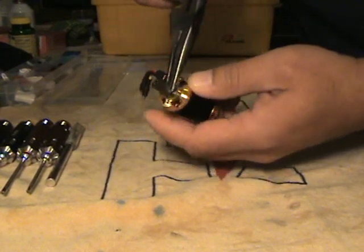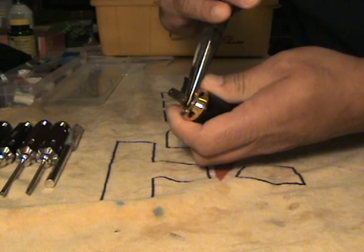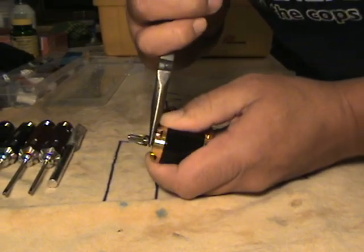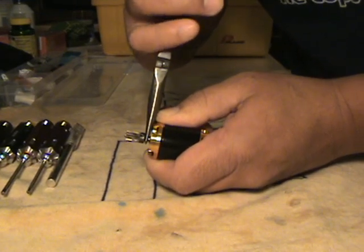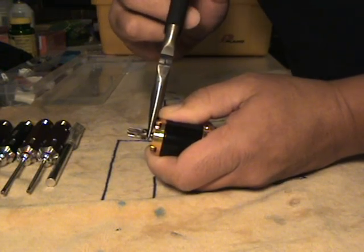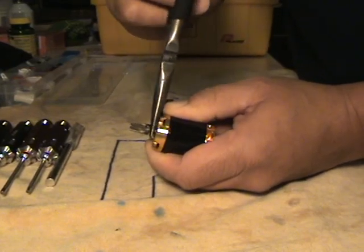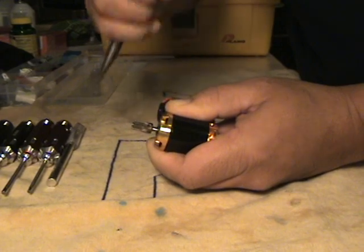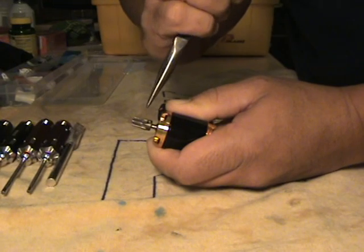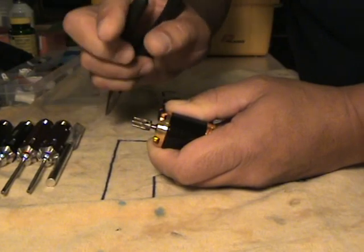Be careful not to pinch these wires here, and just give it a very slight prying action until the pinion moves a little bit like that. You don't want to pry any more other than just to get it moving, because what you'll end up with is this huge angle. If you keep prying, you're likely to damage this portion of the motor, or you'll be applying side loads on the pinion and possibly bend your shaft. Don't want to do that either.